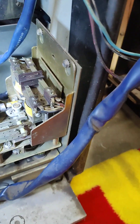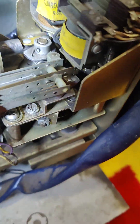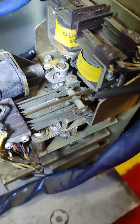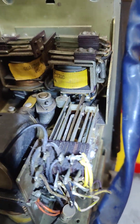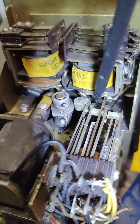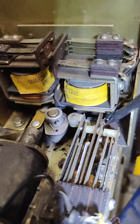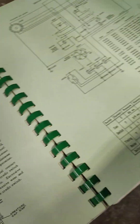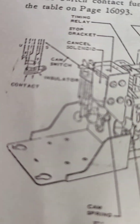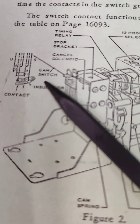Down on the pricing unit, there is a connection — a contact and an insulator pad. You can see there's a wiper right here on this center finger that needs to be making good positive contact with the contact pad to actually write in the selection. You can find this in the service manual right down here in the pricing unit. It's contact T, and it actually talks about the contact and the insulator.